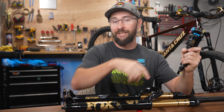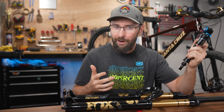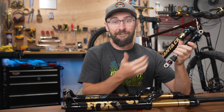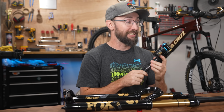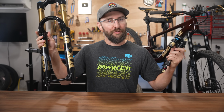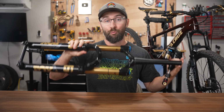But everyone said that this Bronson needs a coil, that it'll feel better, it'll track the ground better, but I still get a bit nervous buying these because you just can't add and remove air pressure to dial it in. You gotta buy a whole different spring, and that can get expensive, and I just hope that the spring calculator was correct. But you know, both of these shocks feel pretty heavy, so let me pull off that stock suspension and see how much weight I'm adding with this.